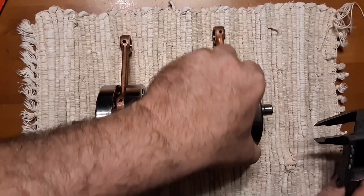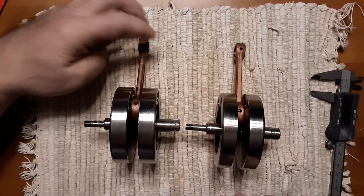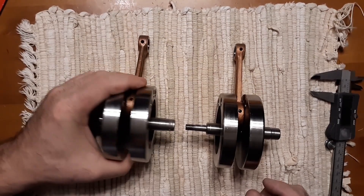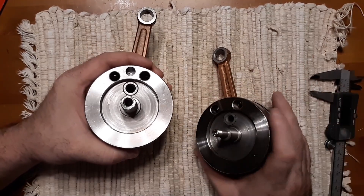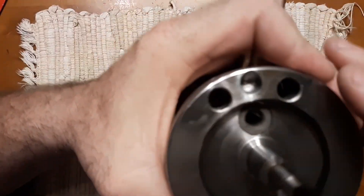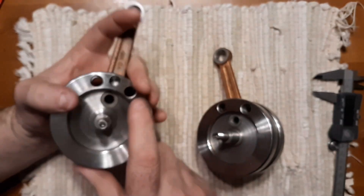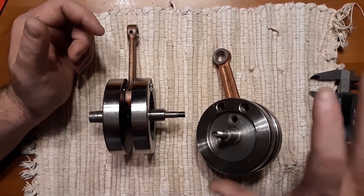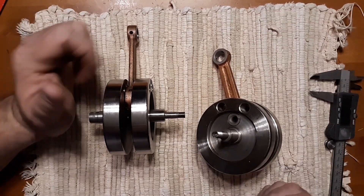So this crank is a lot heavier than this crank, and this offsets the heavier piston a little bit because of all that extra weight. So when you see somebody drilling out holes in these, there's usually three holes in the smaller ones for the bigger pistons, and usually just one drilled up here in the heavier cranks for the same size piston. This one here would take three holes that same size, to balance it.